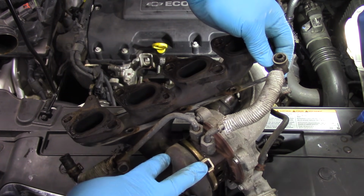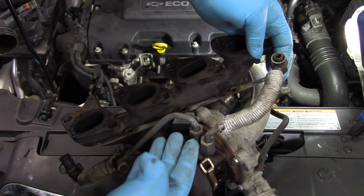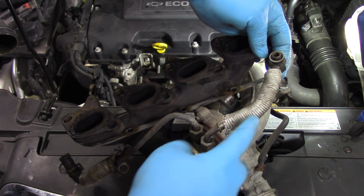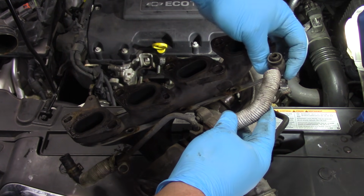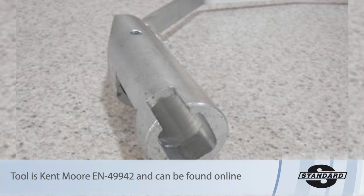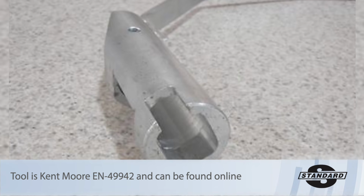See it sitting up here in the front of the vehicle. You can see these coolant lines a little bit better. Now these are up against the engine. Remember, we removed this bracket, pulled the hose loose here. But I mentioned that there was the other line that we really couldn't see real well with the camera. And so here's the line. This is where we're going to take a 17mm socket and use a special holding tool so it doesn't twist, as you see in the image shown here. Just wanted you to be aware of that before you get too far down.